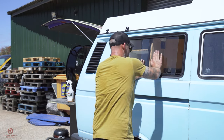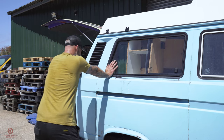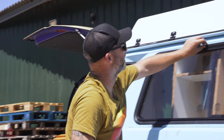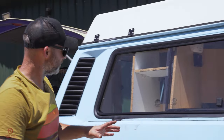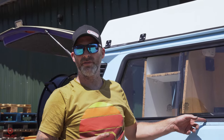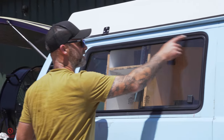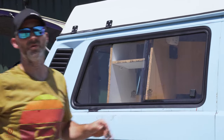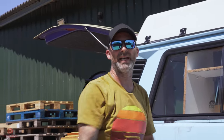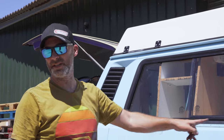As you can see that's still sitting out a little, so now I've just got to seat the frame in. You can see it's seated really nicely all the way around — it's just this last corner, which just so happens to be where it's most crusty. I'll either shove it or bang it in, maybe persuade it with that big flat blunt screwdriver. I have made a right meal of this, deciding to do it outside on my own on a day like today — it's lovely to have Ali but this is his first time. Try and do it with a couple of people and that's even better. The process was: install the rubber around the window frame, put the string around the lip, put loops in the corners, lube the frame, pop the frame in, and then ideally with two people — one pulling and one hitting the frame all the way in. 99.9% of that looks great, but we've got the cupboard in the way and a rusty window frame. I'm very happy with how it fits in, bearing in mind the situation on that bottom lip.